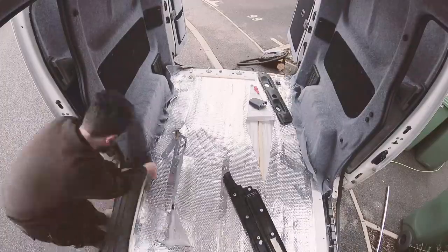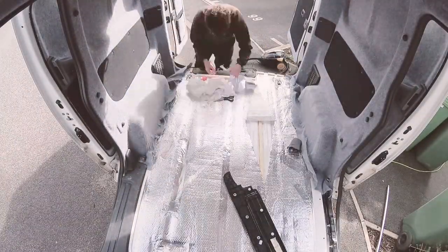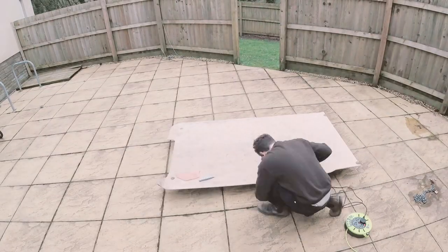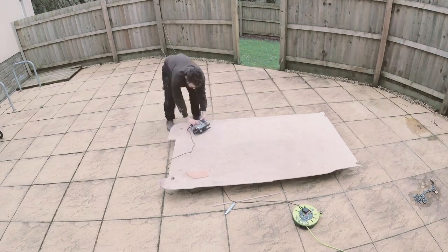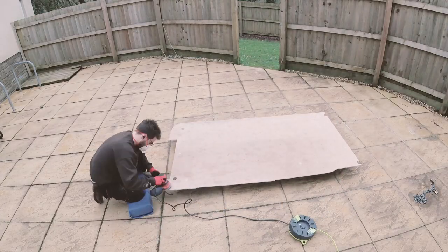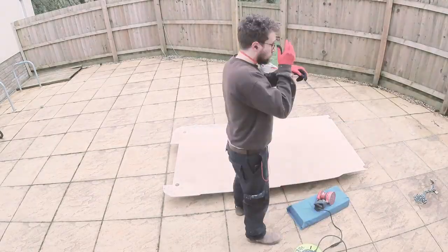The edge of the rear doors has always been quite messy, with insulation and strip wood showing, so this would be a key area to get tidied up. Having removed the floor, I set about cleaning the back of the van. A lot of dirt and sawdust had crept onto the insulation over the last year, and I wanted to clear this before replacing the floor. I was also able to remove the side and rear door trims and get underneath these too. With the van clean, I started trimming the plywood with a jigsaw, using the marks I had made earlier. I would be covering the edges with vinyl, so they didn't have to be cut particularly neat, but sanding them after cutting got rid of any splinters of wood.